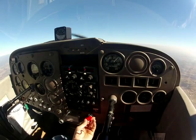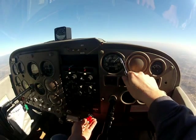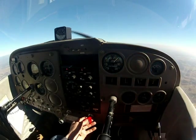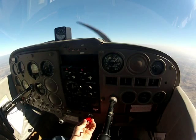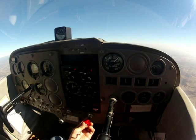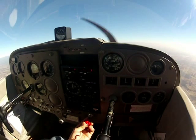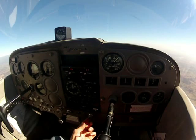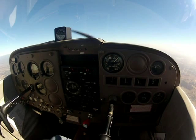So what you can do is you can just slightly pull the mixture back, and then you should see a very small rise in RPM, and then after that it's going to have a drop-off. If you continue to pull out past that, the engine's going to continue to lose power and drop out. If that happens, no big deal — just push the mixture back in and the engine's going to continue to run. So I'm just going to lean it ever so slightly. There's my drop-off — you can see how it's dropping off. So I'm going to go back to that point. That's probably right around peak right there. I don't want to be in that scenario because that's going to be the hottest temperature for my cylinders. So I'm going to push it a little bit richer — a little bit more forward with the mixture control. That's going to be pretty close. That's one way you can do it.